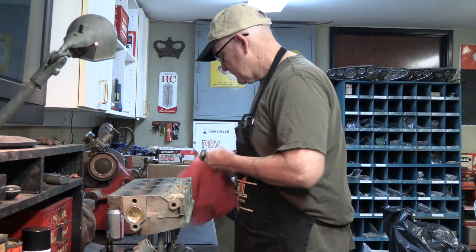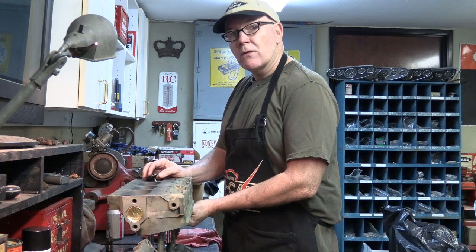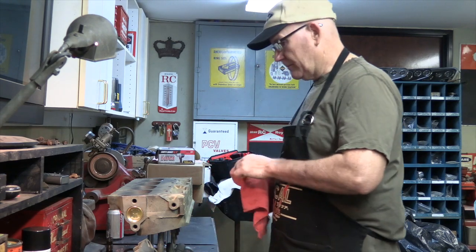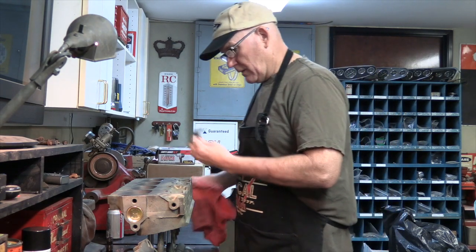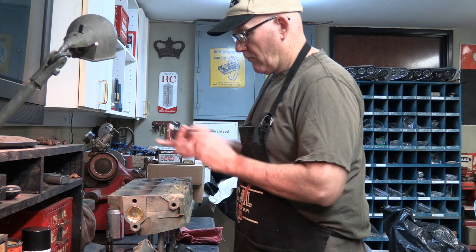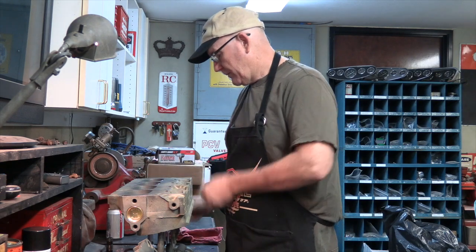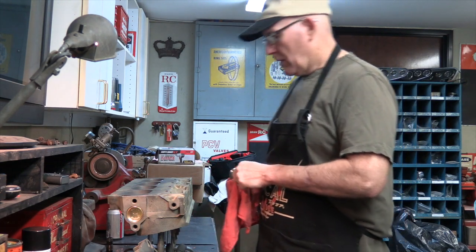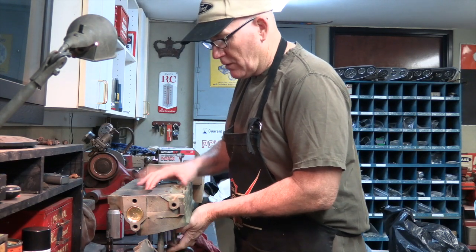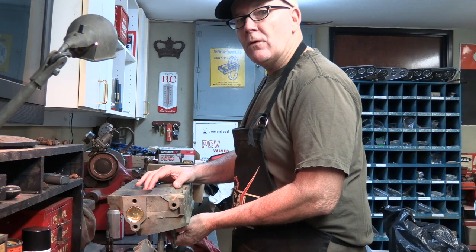That's nice. I'm just looking, as I bang that valve, I can tell exactly where that seat is hitting the face of the valve, and it's right where we want it to hit. So we're in good shape. Okay. So far so good. This sometimes gets a little tricky if you have a machine shop that isn't quite as careful with putting the guides in.